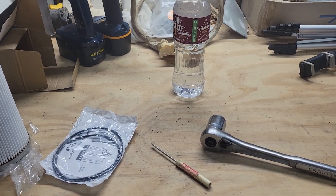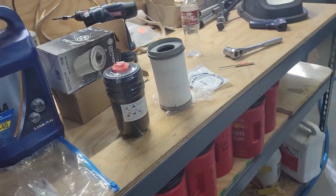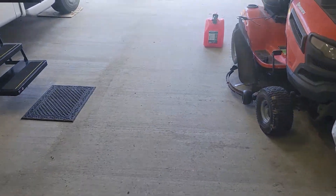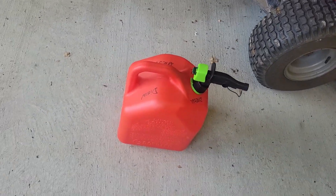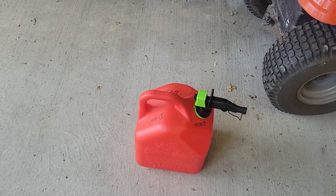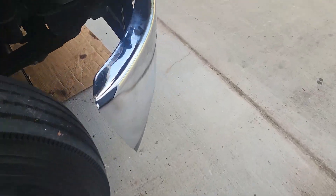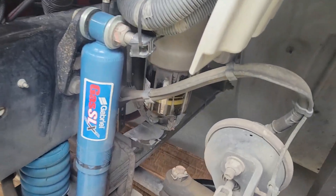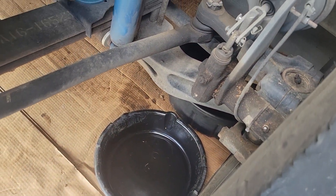It's going to be messy. I've gotten multiple conflicting answers to my question, so I actually called Freightliner directly and they say you need to pre-fill the filters. I had to make a quick run up to the store — yes, I know it's a red can but it is diesel — to buy a little bit of diesel to pre-fill the filters before I put them on. I've got cardboard underneath the filters, and a couple of oil catch cans to catch any spillage.